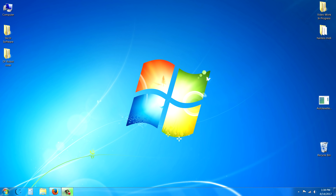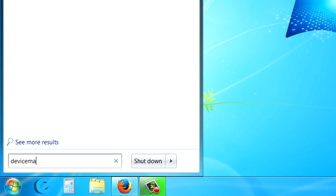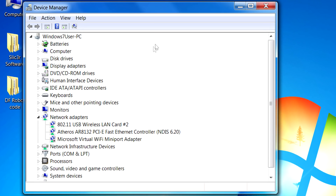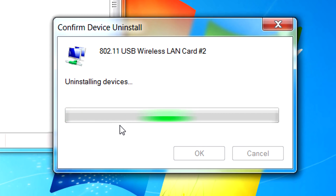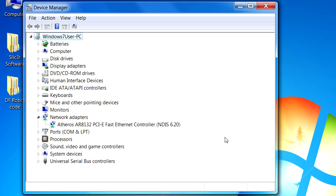If you're still not able to connect, let's go deeper. Click the Start button, type 'device manager' in the search box, and open Device Manager. In the list, look for 'Network Adapters' and click the triangle to expand it. Find something called 'Wireless LAN card' or 'Wireless adapter,' right-click on it, and select Uninstall. We're deleting the wireless adapter and then bringing it back — this will sometimes reset the connection.